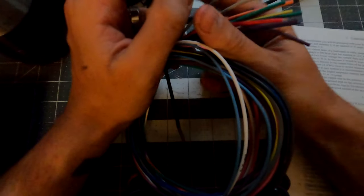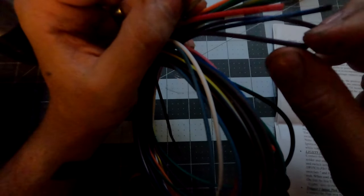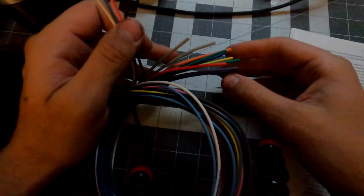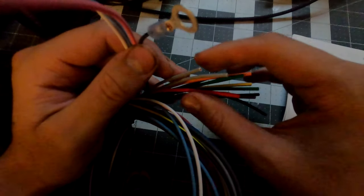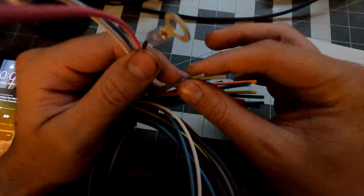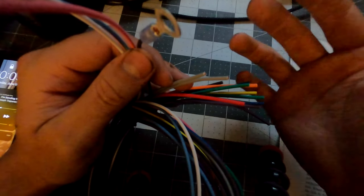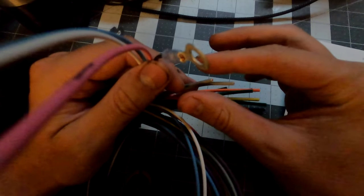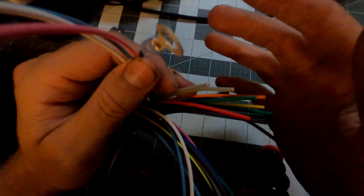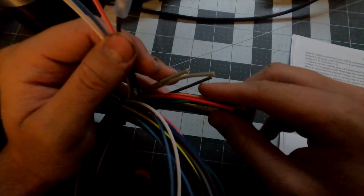After reading through the manual, here's what the wires are. We have two purple, two green, two gray, and two blue - those four colors are all 35-amp output. These are for your larger loads, probably like your rooftop light bar, or if you have multiple puddle pods hooked up to the same output switch. Because there are two wires, they can carry more current.